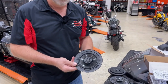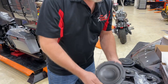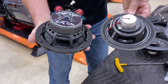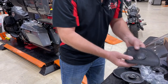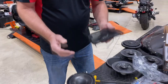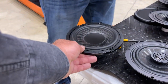Here's your factory front speaker — just to give you an idea, they call it a 6½-inch, but they've got this huge ring so you really still only have a 4½-inch speaker. With the new Wild Boar, just to give you a comparison — carbon fiber cone, larger — and take a look at the back side of the speaker. Holy shit, quite a big difference. This factory speaker has a little tweeter in the middle of it, taking up part of the cone. The new one has a high-quality tweeter in the speaker grill. So this plugs in here — you've got your speaker and your grill together. That tweeter is up out of the way, giving the cone the total chance to move and do what it needs to.